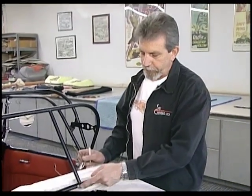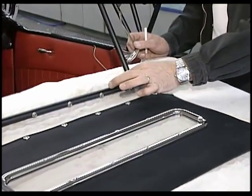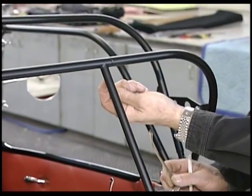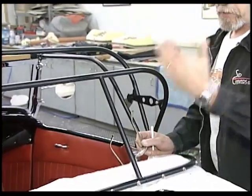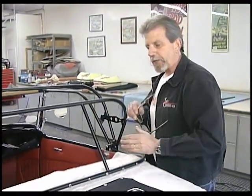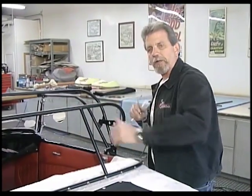Now we'll put the skin on. If you're doing a retrofit of one of our new removable curtain tops, you're going to have to change this snap — it's called a pull-the-dot, and they only go on and come off one direction. You'll also have to measure down and install two snaps in the H piece. If you purchased the top that way originally, all this will be done for you. If you're installing a top that does not have the removable curtain, just ignore this part, snap it on, and go right to the next part.